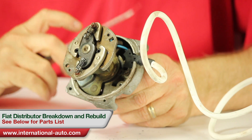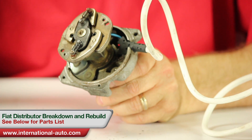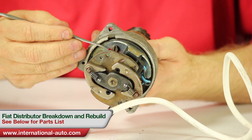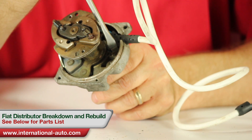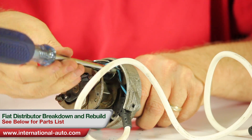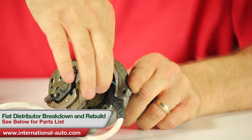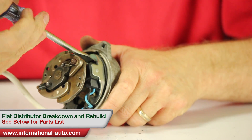The next piece we're going to remove is the ignition pickup itself. There are three screws holding it in — one right here where the harness goes through, and then there are two more over at the pickup plate itself. This is a flat-head screw also. You're probably going to have to turn the shaft to rotate the distributor around so that you can get a screwdriver in there. Once you get the screws loose on the plate itself, you're going to have to actually lift the pickup out of place.